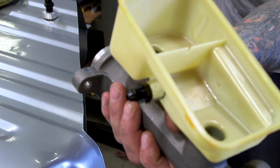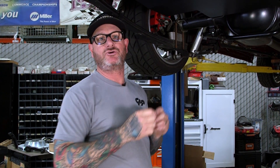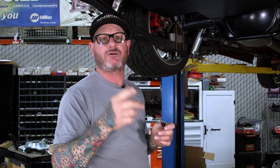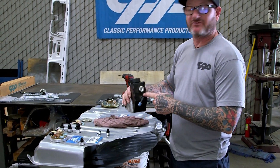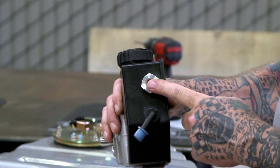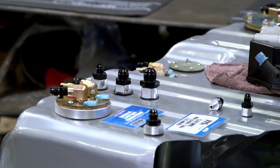If you're running a clutch and you only want to run one reservoir, pop one of these in there and you can run your clutch and your brakes. Another really cool one: if you're running one of our hydro stops, instead of running that Y, pop one of these into the side of your reservoir for your power steering and run a line straight to that. Here's an example of me putting one in one of our power steering reservoirs for our hydro stop — this would be a Dash 6, whereas our vents are Dash 4s, but we also go all the way up to Dash 10.